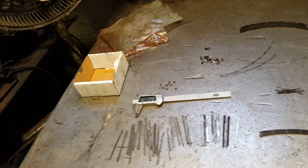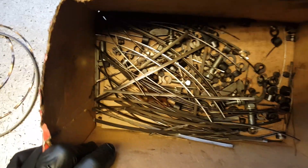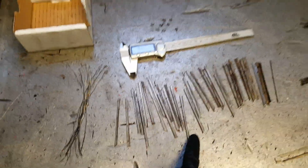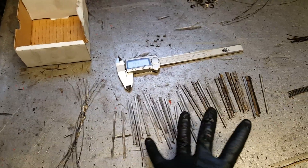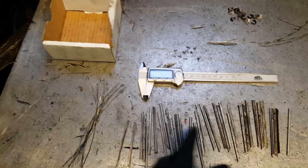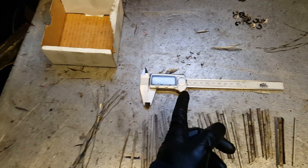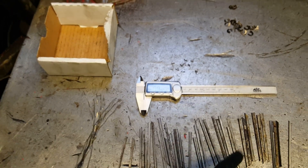I went through one of my goodie boxes — I have a lot more at home. I have like half of the apex seals here. I'm gonna make sure they're between specs. As everybody knows, Mazda spec is 5.3 millimeters; the lowest spec you can go so it can be reusable is 4.3 millimeters.